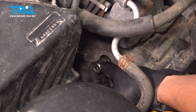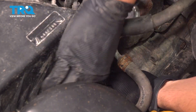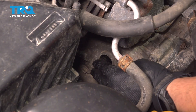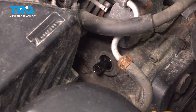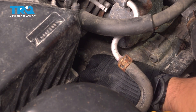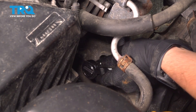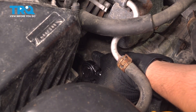Let's drop in a spark plug socket — this will be a 5/8 socket or 16 millimeter. I'm going to put an extension on it before I fully insert the spark plug socket in there. Since you don't have much space with the air box in the way, I'm going to put a ratchet on it. If you have a longer extension, go for it. Keep in mind the spark plug will come out and basically lengthen or shorten your available distance. I have this short ratchet that's going to come in very handy. Just make sure you don't jam your tool into the air box.